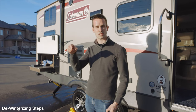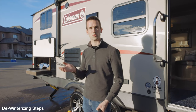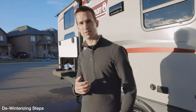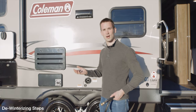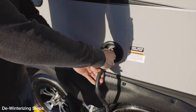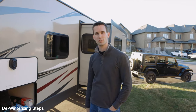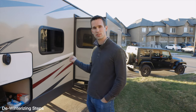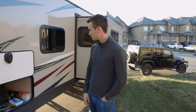The same thing with the fridge — it took a few tries of actually turning it on because when the starter fails it shuts off, so you have to turn it back on, and after about three tries it kicked on as well. Since we've been using the city water connection, we're going to go ahead and fill up the water tank and then turn on the water pump so we've got all fresh water in there with no antifreeze left. The fridges seem to be starting to cool down, and we've also tested the air and still want to test the furnace just to make sure that works.